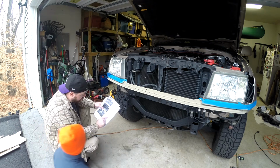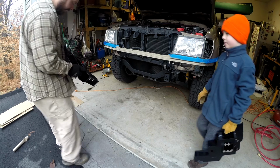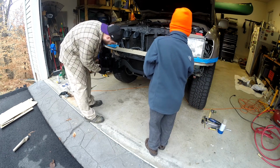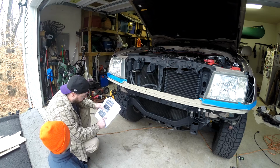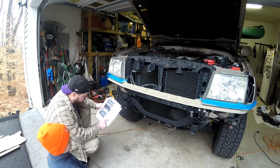And now we need to fit the chassis brackets to the vehicle and secure as follows. The one cool thing about these is they only go on one way, so watch out for the wires and stuff. And then slide it on like that. Nice. On the right-hand side of the vehicle, refit tie down and bracket, tow hook, original 14 millimeter long bolts